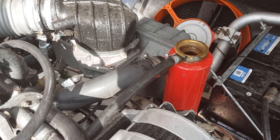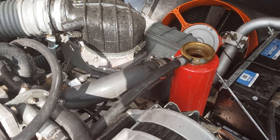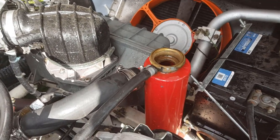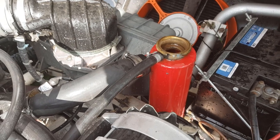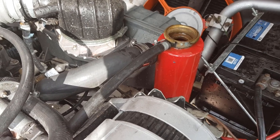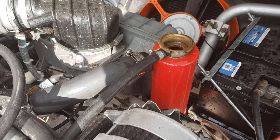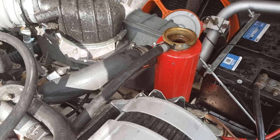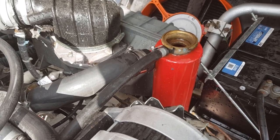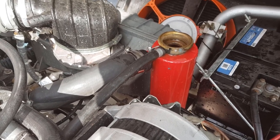That was not a great idea, because I've just realised the thermostat's closed, so it's not going to go down that pipe. So we'll start by putting some in the swirl pot. A little tip here, guys — I learnt this from the Facebook group TVR Enthusiasts, if you're not a member go over and join, really good bunch of people. That swirl pot should not be full — I thought it should be and it kept leaking. Apparently you're supposed to fill it halfway or so. Just bear that in mind if you're new to these cars.